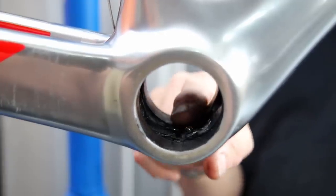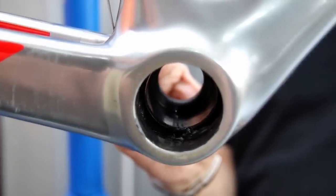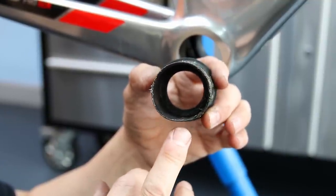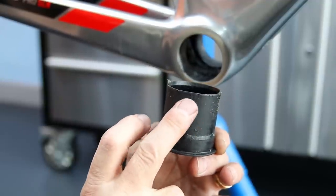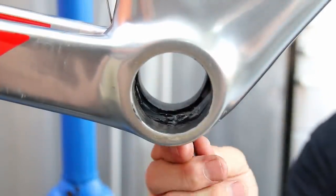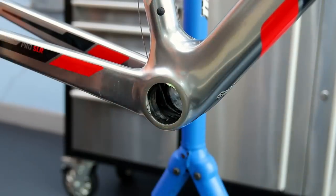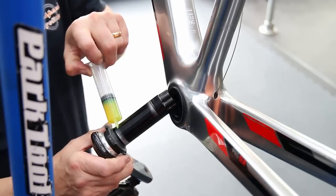Here's the bottom bracket discovery: I noticed the cup on the original bottom bracket was distorted. There's a bolt that holds the cable guide under the frame — it was probably put in from the factory and then the bottom bracket was just rammed in over the top of it. You can see the distortion in the cup; this firm ABS cup could even have caused the bearing failure, as that twist may have altered the seating position of the bearing. There are also under-rotation marks on the chainset. I've replaced that bolt with a shorter one so the bearing cup will now clear it without distorting.